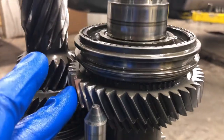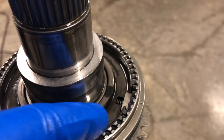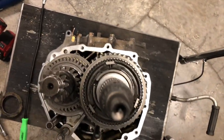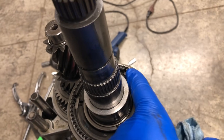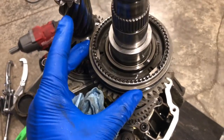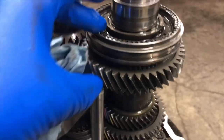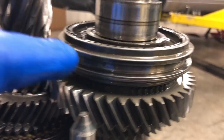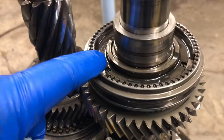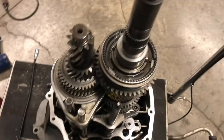Now as far as what we're going to do next — here is that second gear set. Second gear here, and then here's the synchro sleeve. Here are the detent springs and pucks I was talking about. Here's a quick top view — you can see there's three of them. What these do — there are little notches on the inside of the teeth here. The sleeve of course moves up and down, whether it's locking in first gear or locking in second gear. These detent springs help to basically hold the neutral position because there are little slots for the ball bearings right in the middle. When this is in the middle, the springs push into those little slots and act as a detent to help it maintain its position when it's not engaged in either gear.